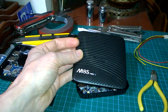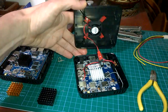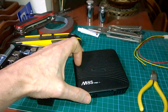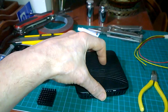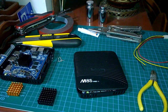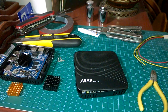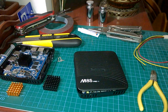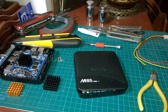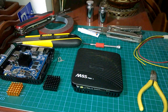I've put a couple of little slots in the lid cut with a Stanley knife, then you just put it back together, screw it down, and it automatically produces a 2mm air gap all the way around. It's brilliant because it keeps the temperature down nicely into a sensible range, and it's silent - that's the main thing, especially for me because I just hate fan noise. And that's my now preferred method for cooling an M8S Pro L by Mecool.